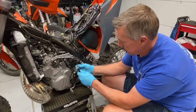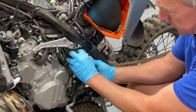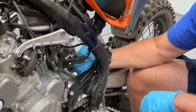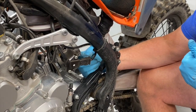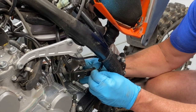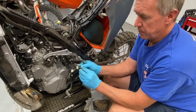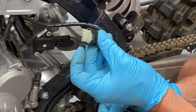I'm going to remove this cover, and after I get it off we need to disconnect the electrical. There's a white tab on the back that needs to pull backwards — it's a locking tab — so you have to pull it back toward the rear tire until you hear it click, and then you can remove the electrical connector. The back clip gets pushed in; you want to pull that back clip out and the whole connector comes out.